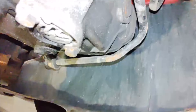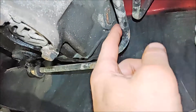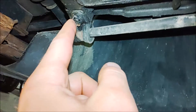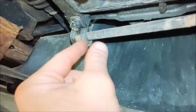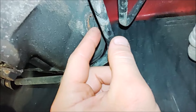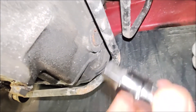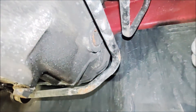In the meantime, I'm going to go ahead and loosen this fill plug. This power steering line here is in the way a little bit, so what I'm going to do is loosen this mount here — this is 13mm. Loosen that up and take this out, and this will allow the line to drop a little bit, ever so slightly, so I can get that 17mm socket on here and remove that fill plug.